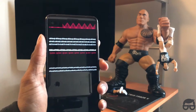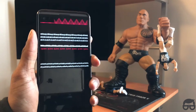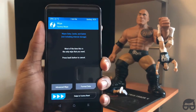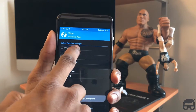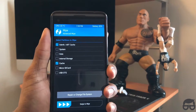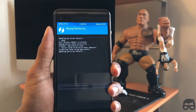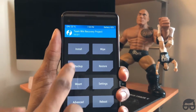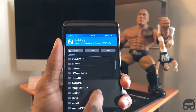I am in recovery now. We're just gonna click on Wipe, then click on Advanced Wipe. You want to wipe the Dalvik cache and cache — it's best practice. Swipe to wipe. Now we're just gonna locate the Converge kernel; it should be wherever you saved it.